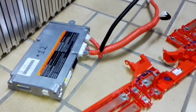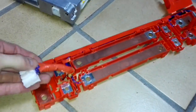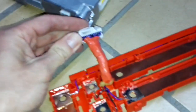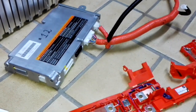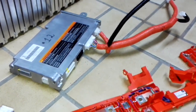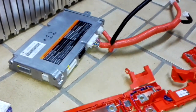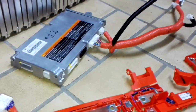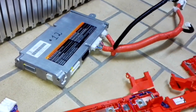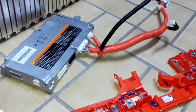The final topic is BMS. The Leaf's original BMS has got tons of inputs, and each of the pole connector assemblies has a wire harness with all these spaghetti wires routed through. They're running a wire from each individual cell into the BMS, which probably works well for their production environment. But the way I'm going to distribute the cells in the car, it's definitely not the preferred way to run little spaghetti wires all over the car. So I do consider just dumping this one and using an updated version of the BMS I'm currently using in the Polo, because that works rather well.